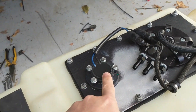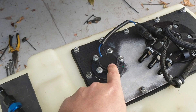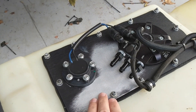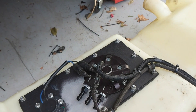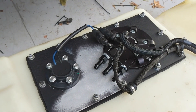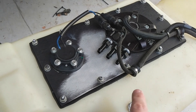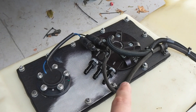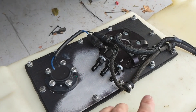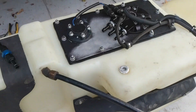I had a machine shop fill that in completely except for the sending unit, and the sending unit I put in a 12-volt because I've changed out the gauges. So when they filled this completely in, I was able to drill a three-and-a-quarter inch hole, drop this thing in, and now I've got a Walbro 255 in the tank with Holley's Hydromat in there.